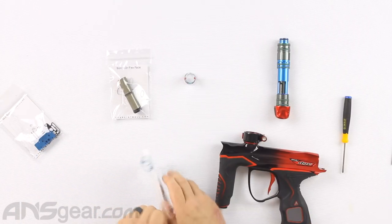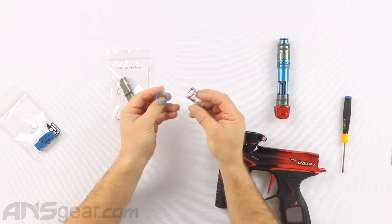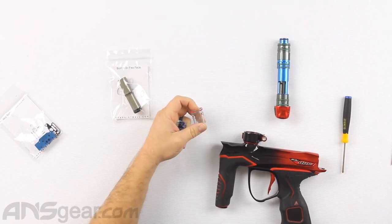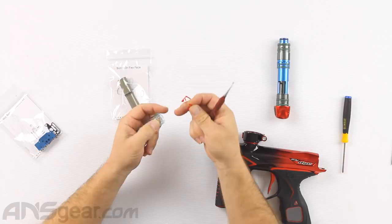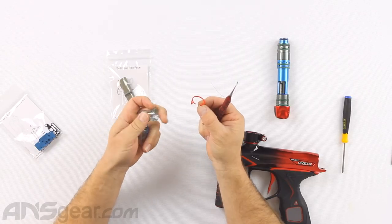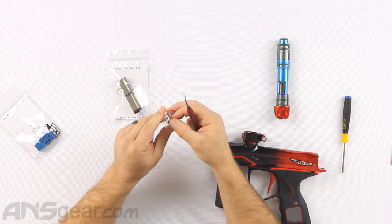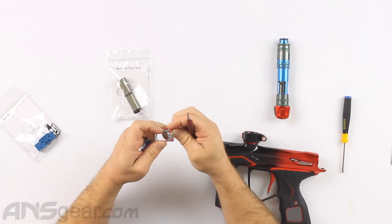The I-Pipe now has a different material for the detent system itself. The detents are individual — there is a left and a right. Before, the detent was a solid ring, one piece that went all the way around. What they found was over time these would not retain their springiness, becoming loose and sloppy. So they redesigned it and came out with this 4th Gen I-Pipe, which has individual sides made out of a completely different material for the detent itself.